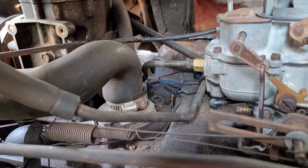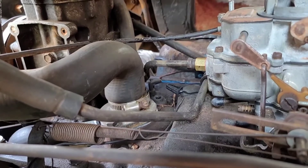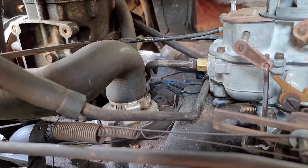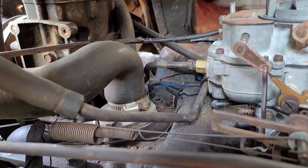That's generally how you can tell. To verify, I did pour a little gas in the carburetor and it did fire off. So that's how I knew I had a fuel pump problem. Hope this helps.